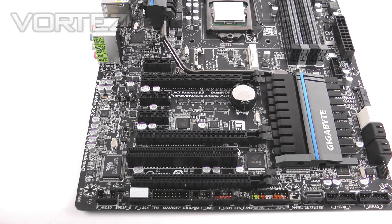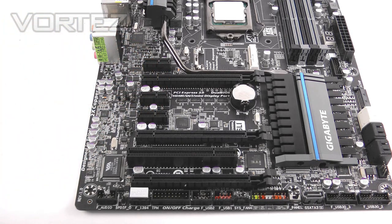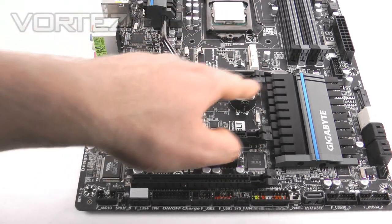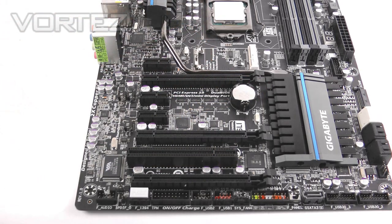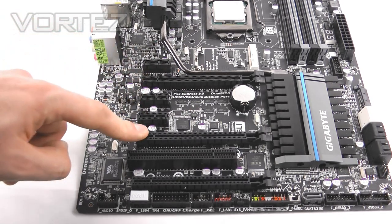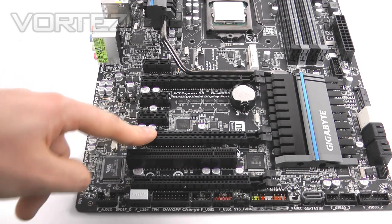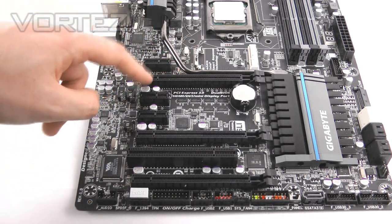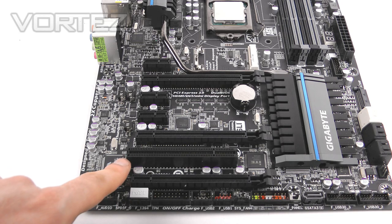For PCI Express we've got various options. There are three PCI Express X1 slots — ideal for the Wi-Fi card Gigabyte includes. It's nice that the top slot is an X1, providing clearance for the graphics card and CPU cooler — if the X16 were at the very top there could be a clearance collision issue. We've also got three PCI Express X16 slots. In a dual card configuration the middle drops to X8 and the bottom to X4, so for a single card use the top X16 slot. And just above the bottom PCIe slot there's a legacy PCI slot for older devices.